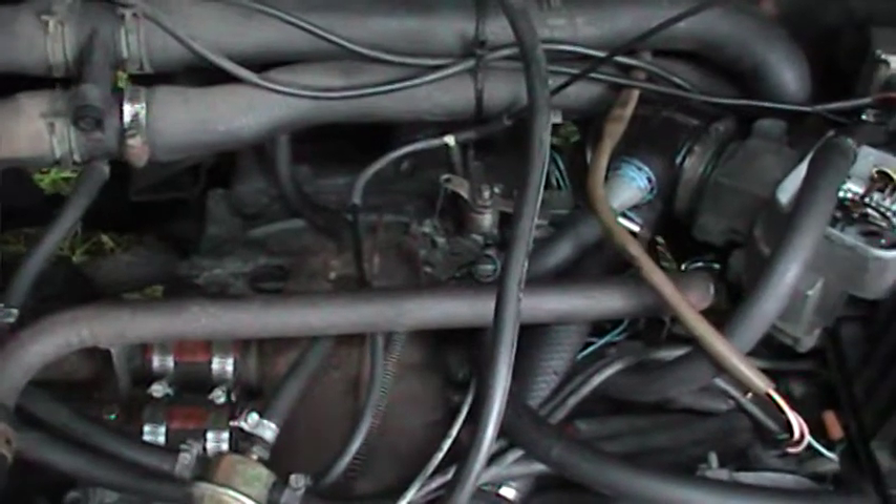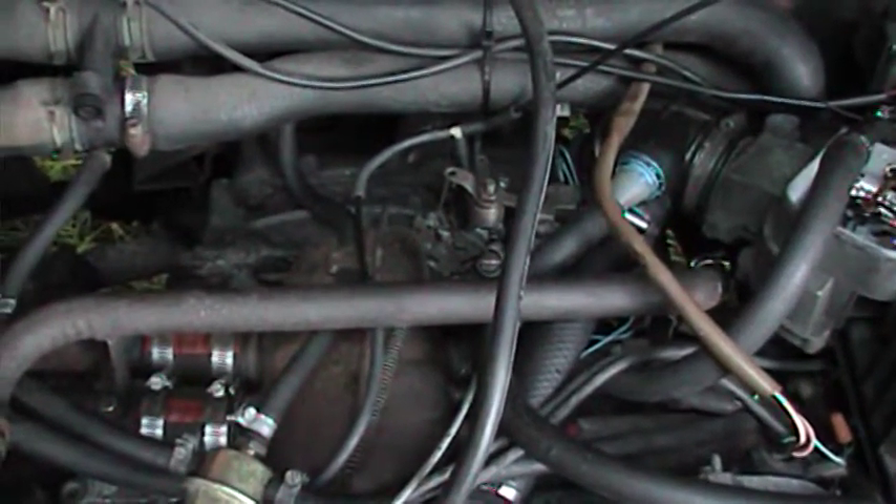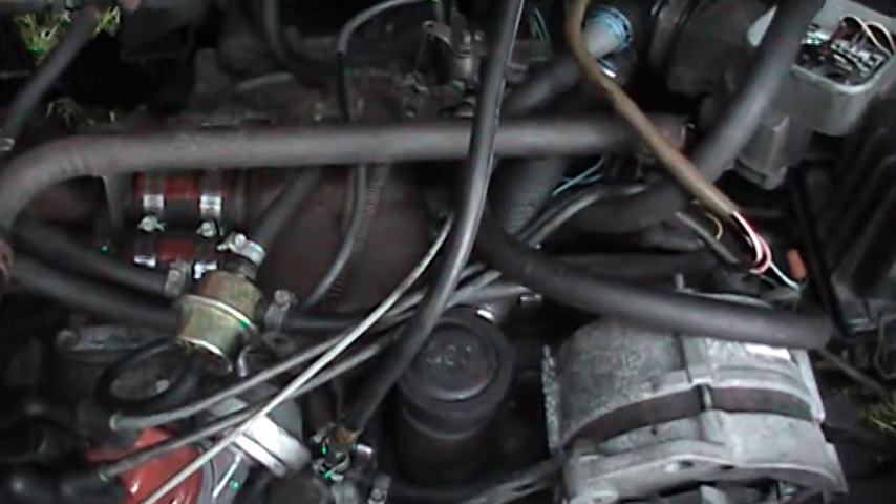I'm going to disconnect the vacuum advance as well — well, I'll keep it on, demonstrate the fail one more time, then get it running again. Hopefully you guys will be able to figure this out for me. I couldn't even get it back running. It ran when I re-plumbed everything, but couldn't keep it going. Timing marks were about in the middle. Got it to rev, hold the rev about one time. But it's just obviously not anything I can drive in this condition. Super frustrated and don't know what to do. Hopefully there's somebody out there that has another test for me to run or wants to see some other diagnostics or has some advice.